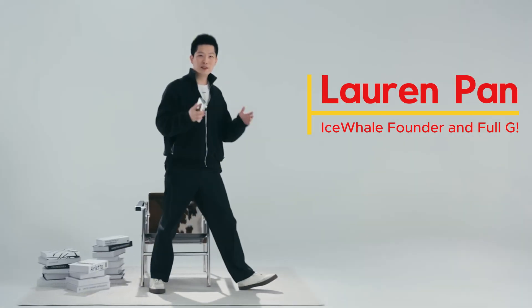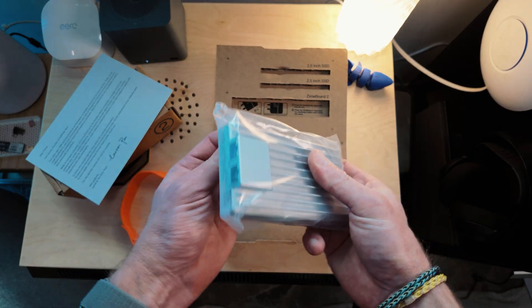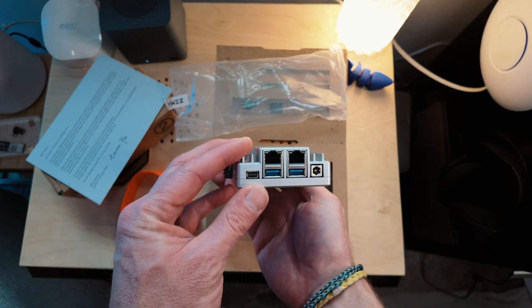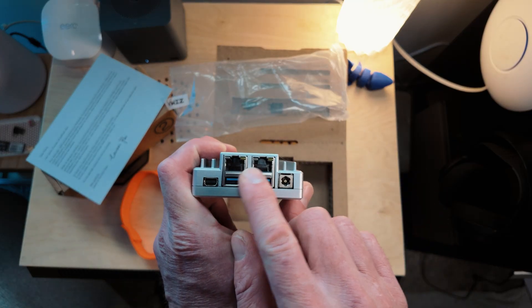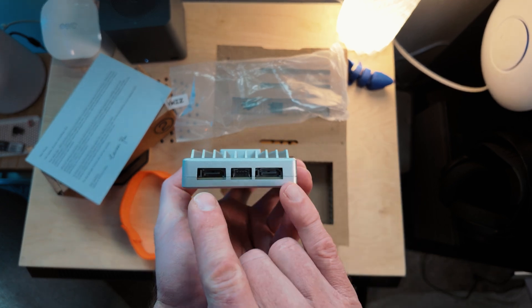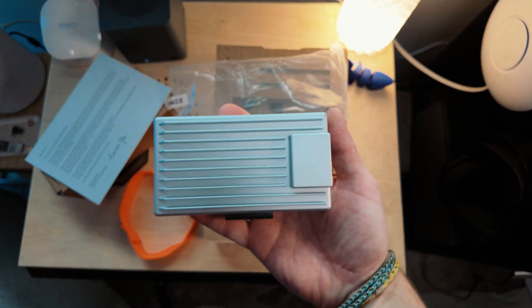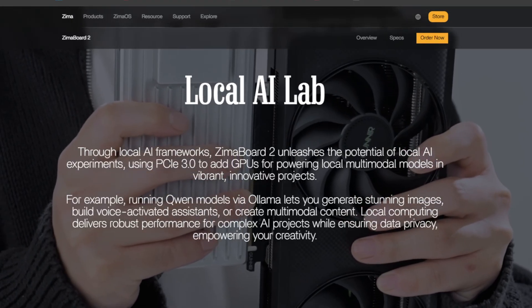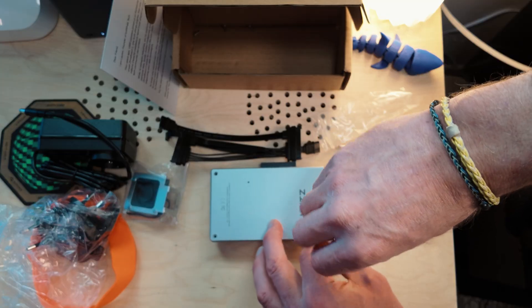I think it's really cool to support a company that truly understands the ethos of many of us home labbers. Now let's get on with the show, because here is the real star — the ZimaBoard 2. At its core, the ZimaBoard 2 is an x86-based board running an Intel N-series CPU, with dual 2.5 gigabit ethernet ports, native SATA ports, a PCIe slot, and passive fanless cooling. That combo alone already tells you who this is for — this is a set-it-and-forget-it server that's quiet and efficient.